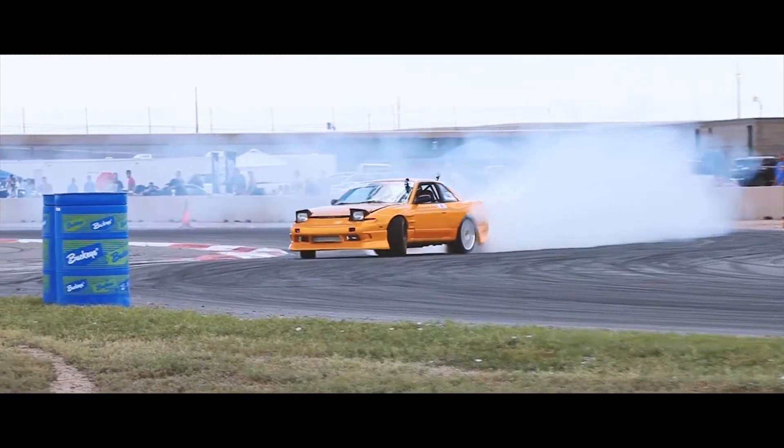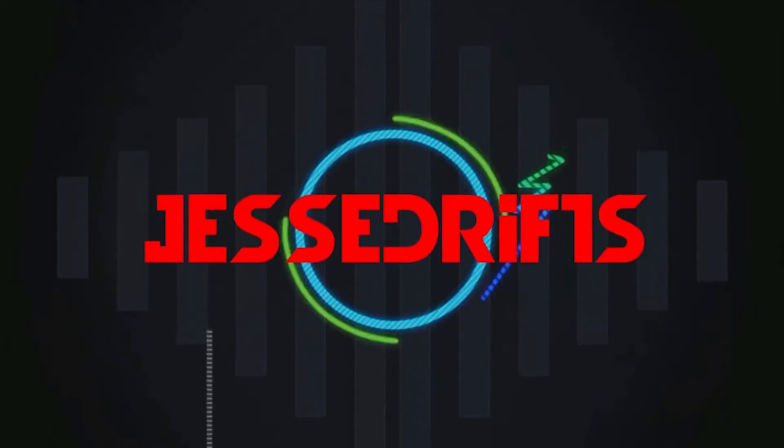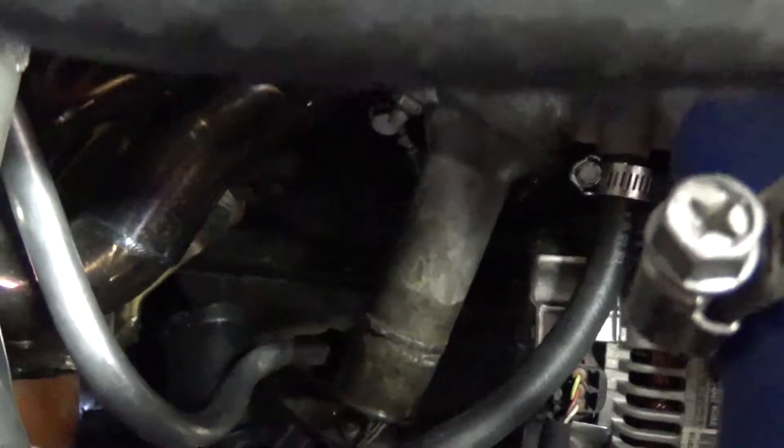You are watching a master at work. So today I am fixing a coolant leak. I just took off the lower radiator hose — it's leaking from that seal. I think it might be the gasket because the thermostat's supposed to hold pressure off it and it's cold and it's still leaking coolant from the engine, so I think that gasket in there is bad. I'm gonna try and replace it.